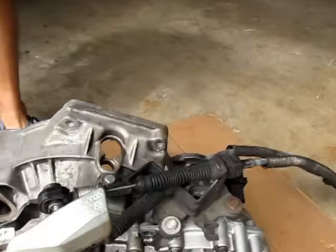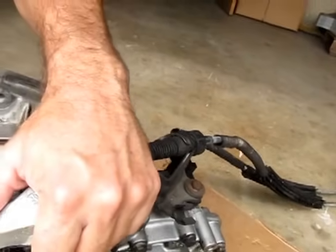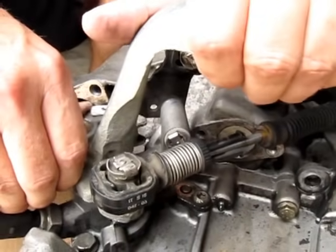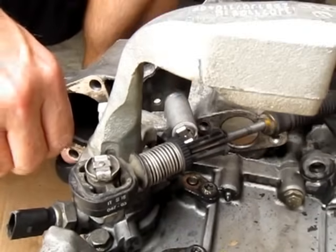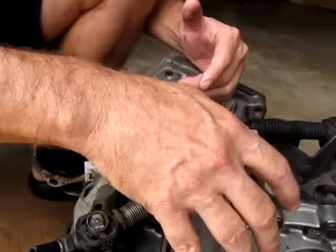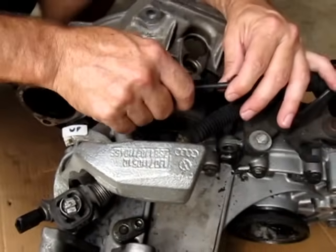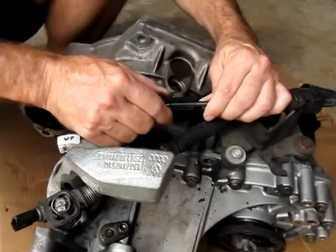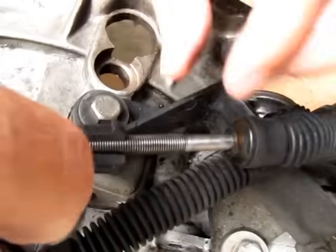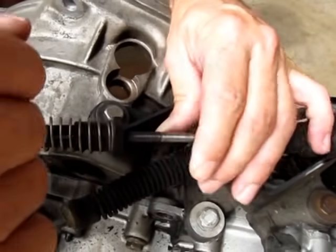Go back into the engine bay. You're going to go down just a little bit — about a quarter to a third of an inch — and rotate it clockwise. That's going to put it in the first and second gear gate, at the height of the first and second gear gate. You can see there's still a lot of movement here. Pull all the slack out of the system, and then once you get all the slack out, release the cable end.